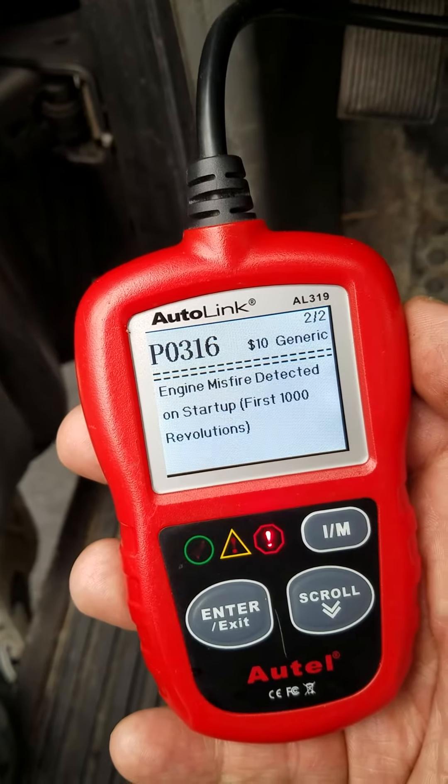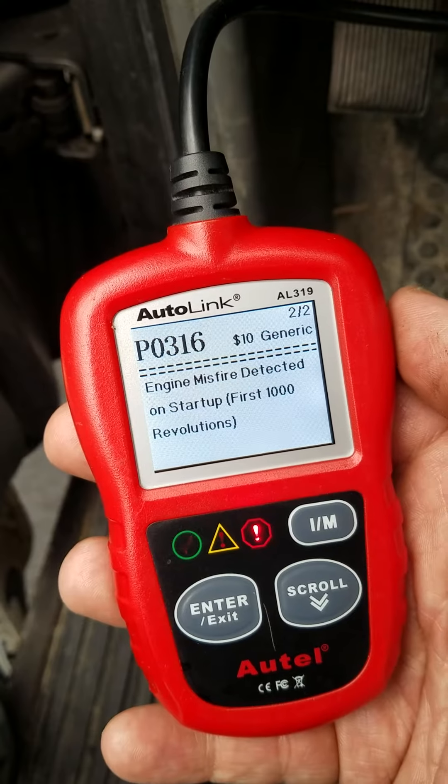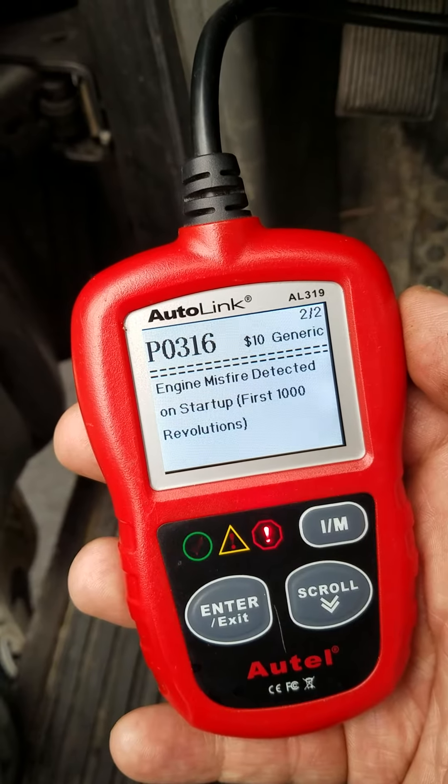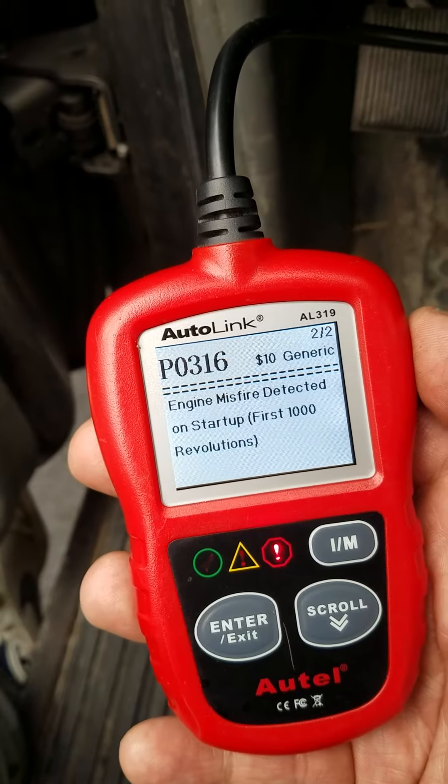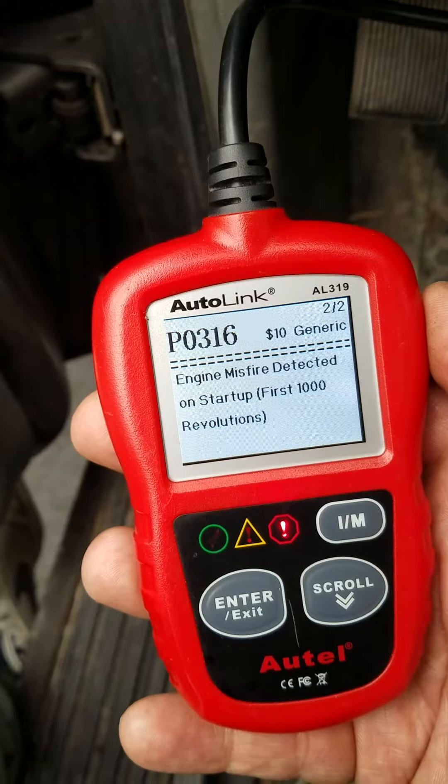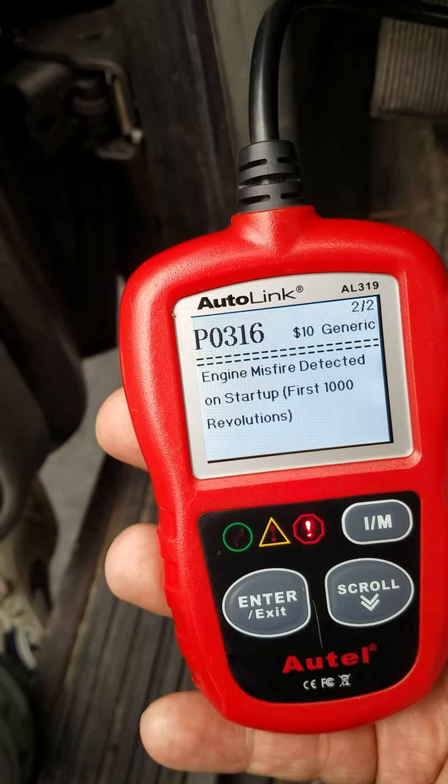So I think I have to go buy myself a fuel injector. But if it was a hard misfire constantly, I'd be doing some spark tests and coil tests. But I feel like I've been having this problem for a little while, so I'm going to wind up putting fuel injectors in anyway.